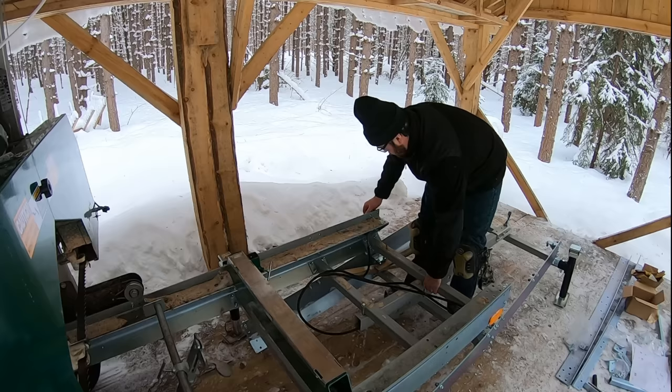Now this is the old end section that used to sit right here. You saw me slide it over top of the new section that I built. And then in order to get that old section, which is now the end section, into place, I used this strap here to take the weight of the tongue. Now you could just as easily take that tongue piece off. That tubular steel piece with the hitch on the end, with the coupler, that's actually got some weight to it. So if you take that off, that'll make that end piece quite a bit more manageable. I just thought, you know what, because I'm inside the shed here, I got a strap, I have a cross member up there, I would just use the strap to hold it parallel, and then I was able to slide it right into place. So that's what you see right now.